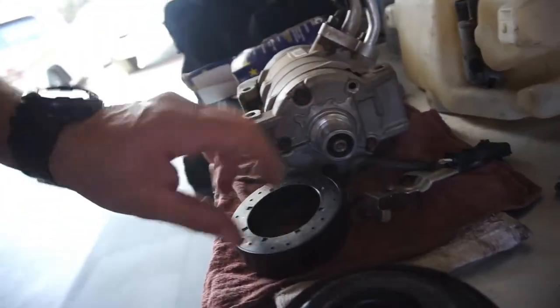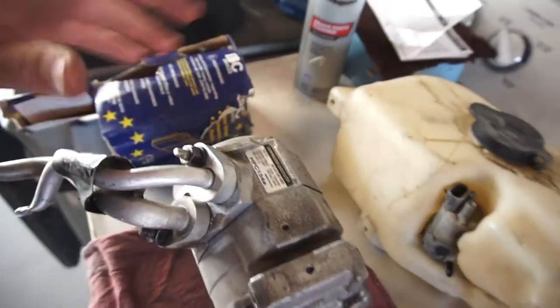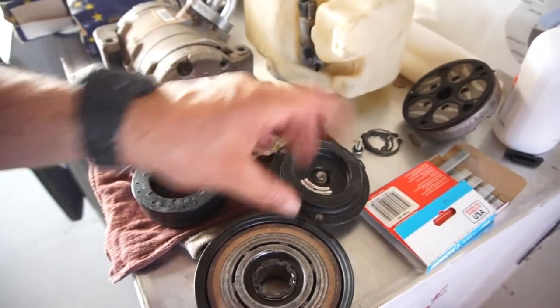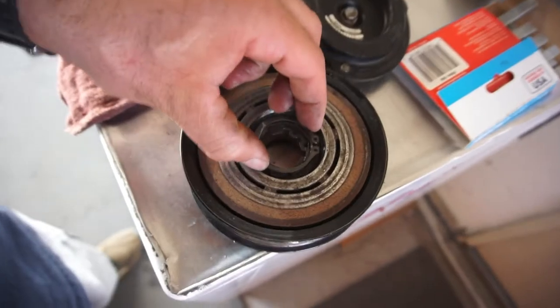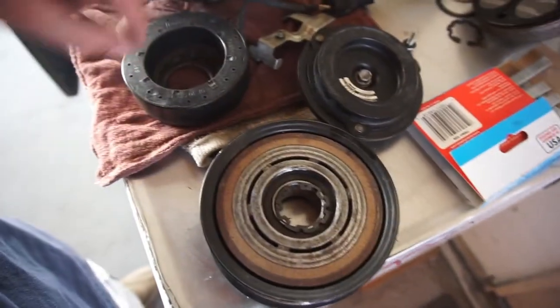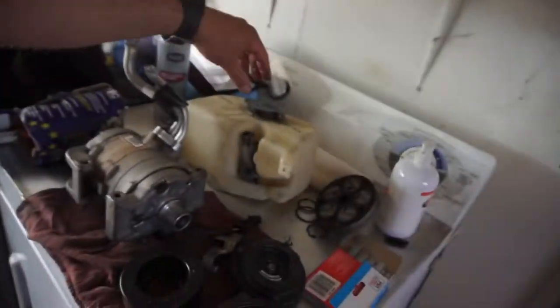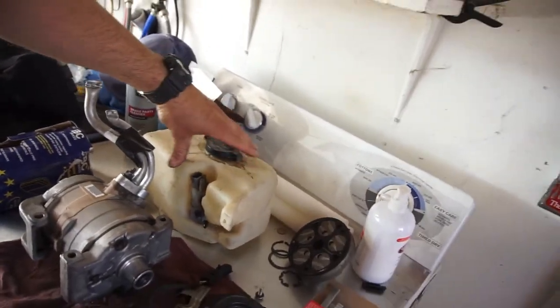I found another compressor but it was completely different — it had three screws holding the magnet on, just way different. It was a 10S-13 something, and it didn't have this type of C-clip. The C-clip it had was for the pulley — a regular C-clip instead of this wavy C-clip — and then inside instead of a C-clip it was three screws, so way different. I also ended up getting a used windshield washer tank — it's not all brittle, still pliable, so that can go into Project Crack Pipe.